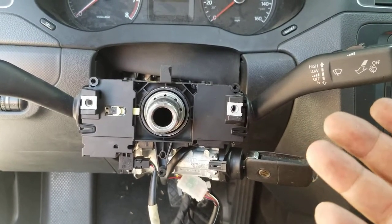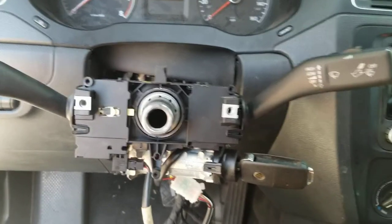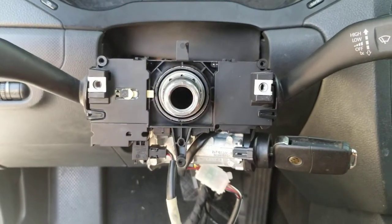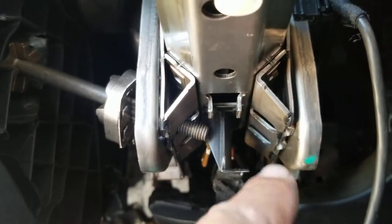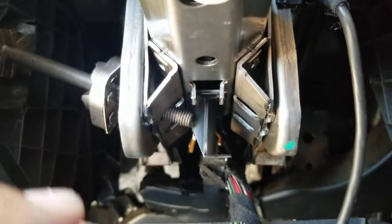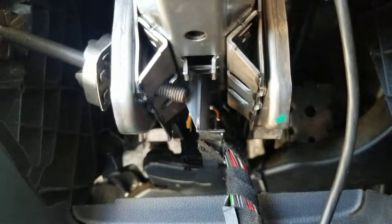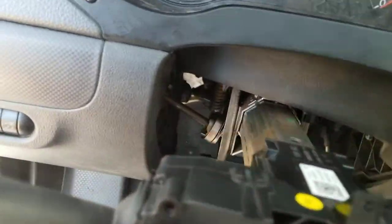If you want to do it that way, what I did — because I didn't have the tools available, I had went out and came back and finished the job. But the easier way I found out to do it is you take off the nuts on either side of the bolt, move that bolt over. So that's for the telescoping. That'll let you get these tangs over, which gives you about two inches of travel towards you with the steering wheel.